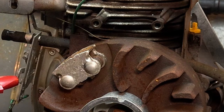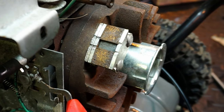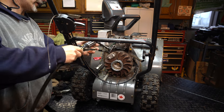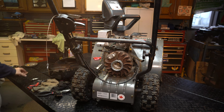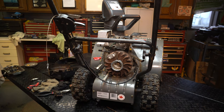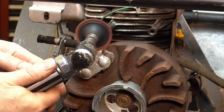I'm going to clean this up, clean this up as well, and then do an ohm meter reading. You can see how rusted that is — there were chunks over here which I pushed off with my finger. We've got all the noise going on in the shop so I'm going to use an abrasive wheel because this is pretty bad. Trying to keep the dust away from the camera. Now we're just going to do the rest with a Scotch-Brite pad, ensuring a good connection.